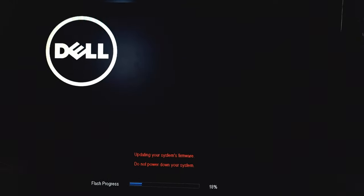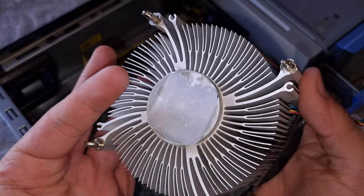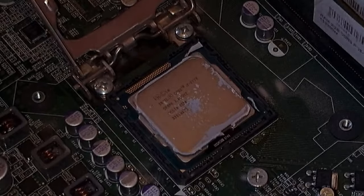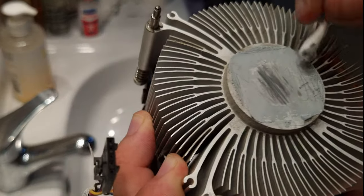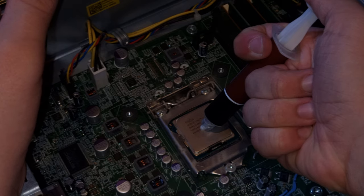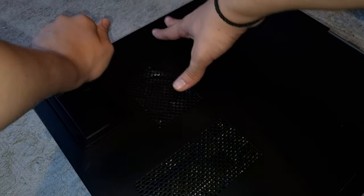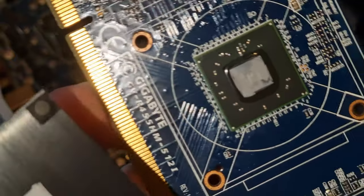All that's left is to update the BIOS of the working computers to the latest version and repaste the processors and chipsets. This wasn't easy, as the paste was solid as a rock and the thermal paste flakes broke apart like plaster, meaning it had been a very long time since the last repaste. Thank god no damage occurred to the CPUs. To clean off the thermal paste from the IHS, I scrubbed it with a cotton bud with isopropyl alcohol after scraping off the dry paste from the sides and edges. The same applied for the coolers, though it was challenging and took a ton of time even with elbow grease. After cleaning, I applied some Noctua NT-H2 thermal paste, which is quite overkill for a PC like this, but that's what I had. The other Dell was the same story — dried thermal paste on the CPU, and the GPU heatsink was stuck to the GPU die like glue.